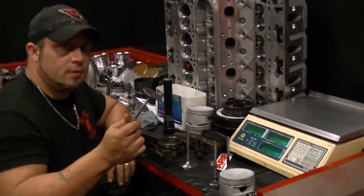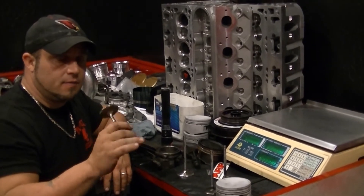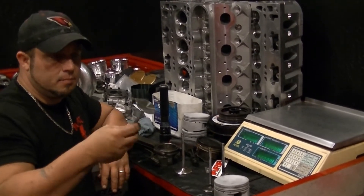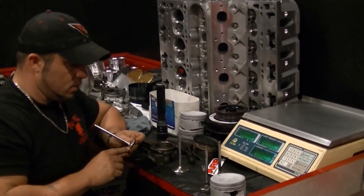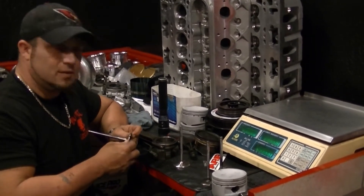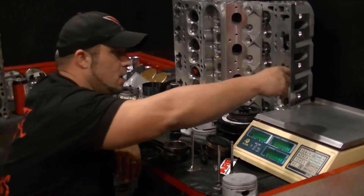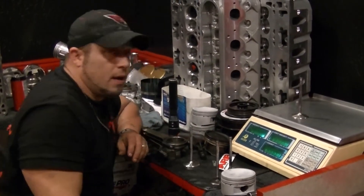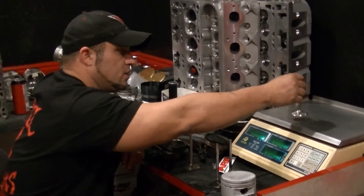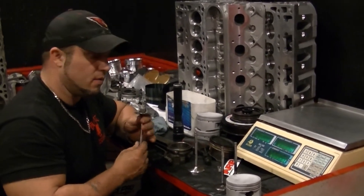We're going to go to a race-inspired Rev cylinder head valve. This is a lightened valve — it's stainless steel, nice back cut, gets a swirl. It's actually only one angle, which is kind of funny because it's race-driven. The LS3 is actually three angle. We're going to put this on the scale. This guy's popping out at 110 grams. It's a little bit bigger valve — this is a 208 intake valve, a little bit bigger than the 2-inch.